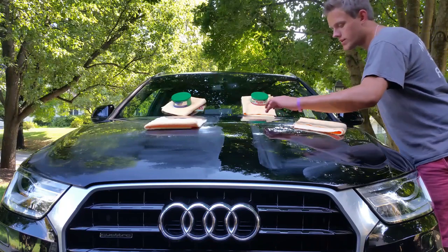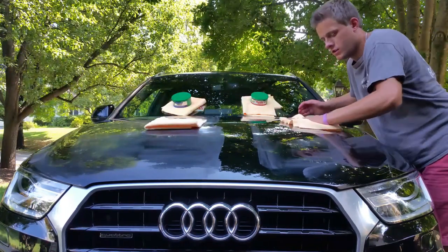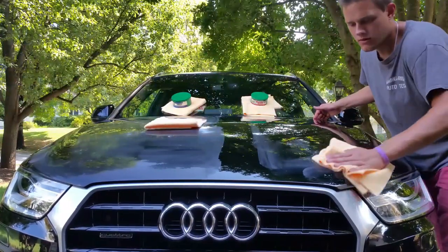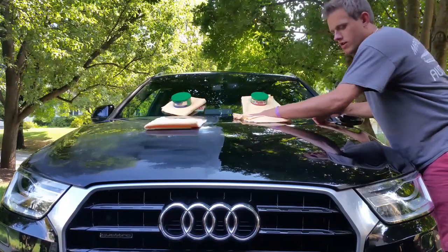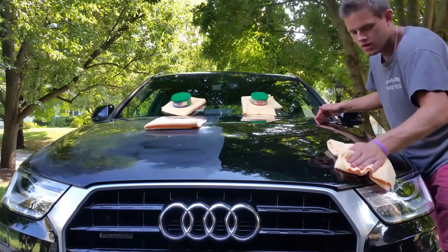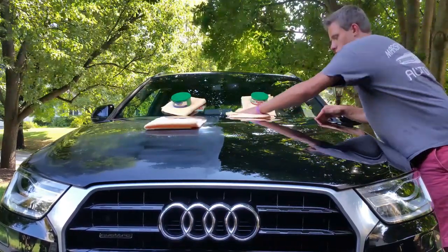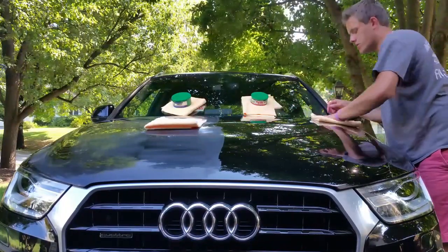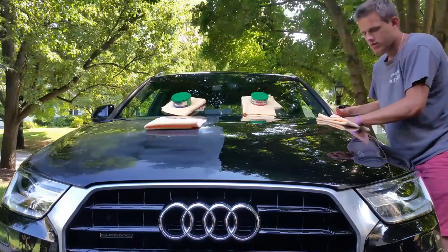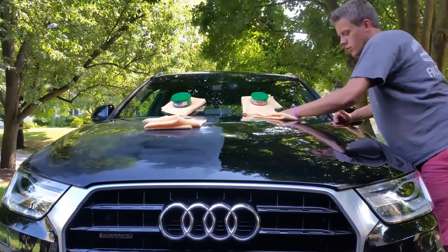So now I'm going to wipe off the wax. You rub your finger down the middle and you can tell when it's dry — this is obviously dry, so now we're going to buff it off. Slowly buff it; don't apply much pressure. You don't want to put anything unwanted into the paint. It buffs off very easily, though a little bit more work than most brands I've used. This wax has a uniqueness in that it just seems like it's a lot harder to take off than most waxes.